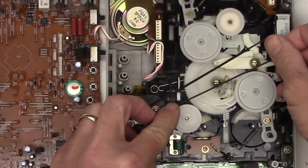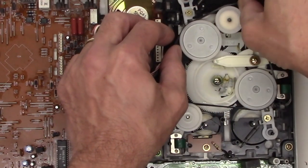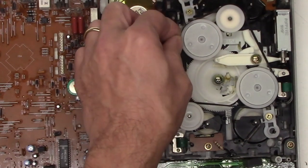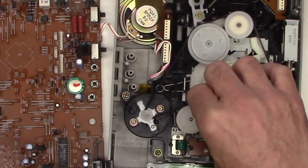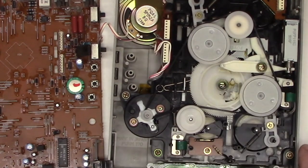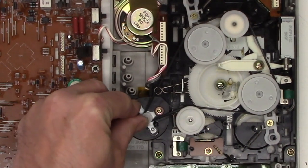Now we'll go ahead and place the new belt in here. I want to make sure that it doesn't have any twists or turns as it goes — I'm going to try to straighten it out completely. There it is, no twists and turns. Before I put it back together, I've got my light machine oil — very light oil — and I'm just going to give the motor a little spritz of oil to get it up under the motor so the brass bushing has a little oil.